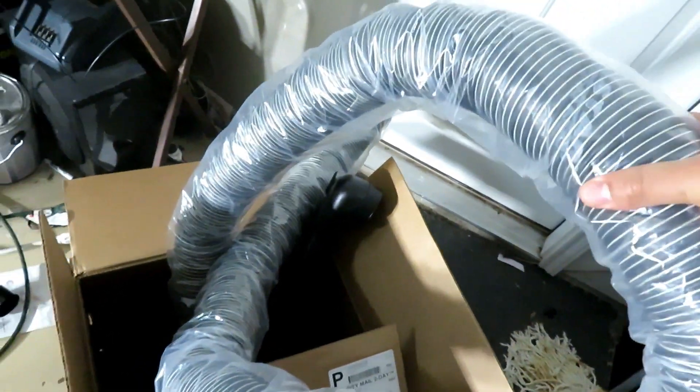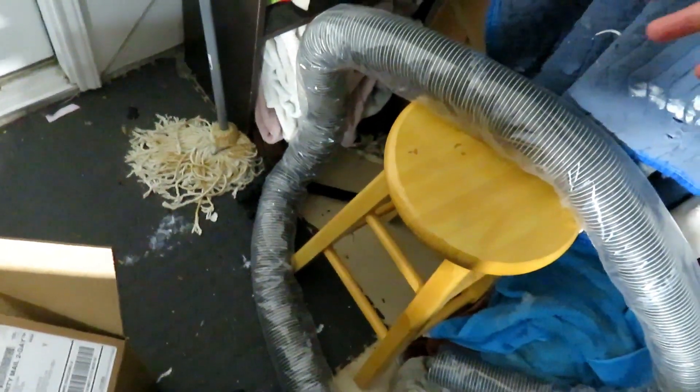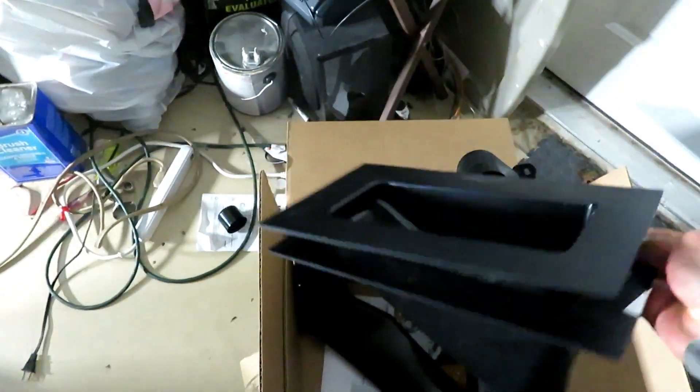Some of the materials I have here: I have the actual ducting. There are two different kinds - a black version and an orange version. The orange version is rated at 450 degrees, the black version is rated at 300 degrees. I went with the black version because it's moving cool air towards the brake, not hot air, so I didn't spend the extra $10 or $15. I also have C6-Z06 ducts that curve around the wheel well, and universal ducts to put behind the fog light after I cut the trim off.